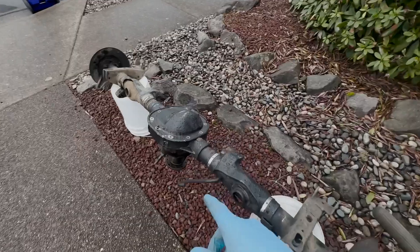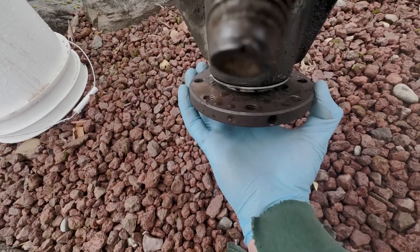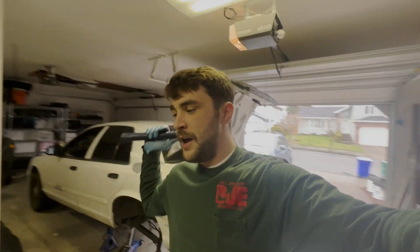There's no guts inside of it because I have those over in the vice, but listen to this bearing here. I don't know how well you can hear that on camera, but it's going while I'm turning. So that pinion bearing — one of those two pinion bearings — is totally shot.